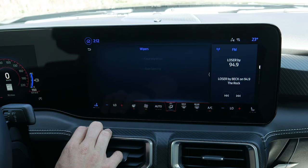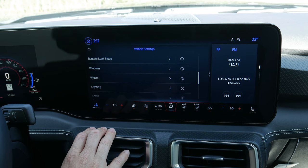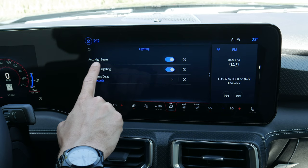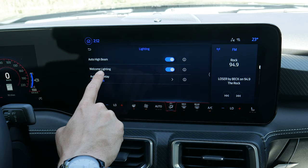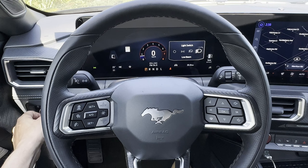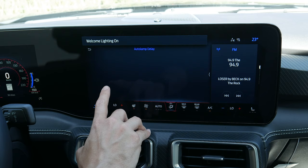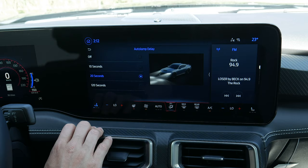On the convertible, both front and rear windows roll down; on the fastback it's just the front. That's remote-down only — manual backup. Options for wipers: courtesy wipe does one extra sweep after the full wiper cycle to clear excess liquid, and there's rain-sensing wipers. For lighting, auto high beam in auto mode automatically turns your high beams on and dims them — you don't need to manually flick them. Welcome lighting approaches the vehicle, and you can set how long lamps stay on after locking: 10, 20, or 120 seconds, or off automatically.